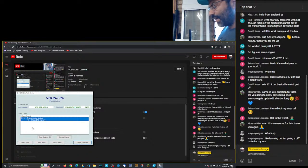So here we got a check engine. We got a code for the brake module. A lot of times, these codes, again, are deep dive codes. These are not codes that you can get with a normal OBD2 reader. These codes are module specific, so you won't get a P code, like a P0131 and all that. These are the codes that you're going to get that are hard to find. They're dealer codes, B codes. These codes are in-depth. You need a big tool to do this, to get this information correctly and accurately, and understand what's going on.